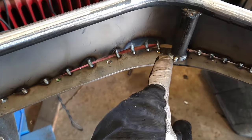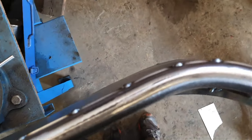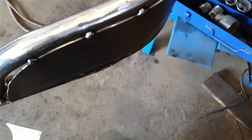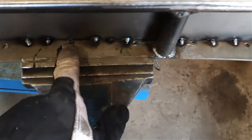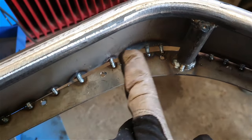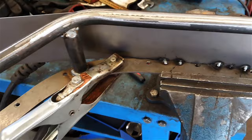You can see I've had a few issues here. I've modified the shape to be more to my liking — just a kind of slight incline — and I wanted to keep that uniform all the way around. I've basically had to bridge the gap to keep it that way, matching the other one, and then correct that bit on the first fender. We'll have to do something about these bolt holes — weld studs in if need be — which will be bridged with weld and filled. When it's ground down it'll look nice, and we'll use a little bit of filler on some of the welds to tidy things up and make it look professional.